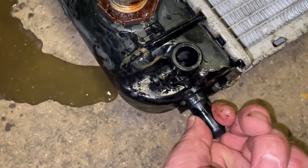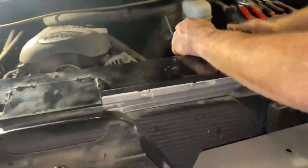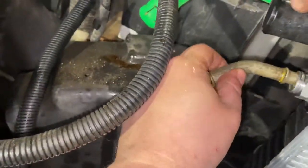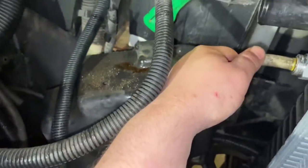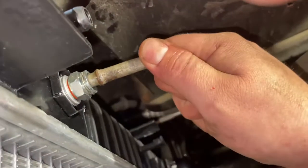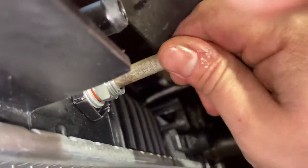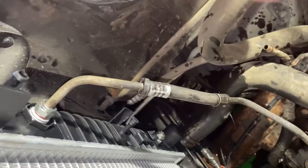The bushings click in. Jamie's over here tightening the first bolts up top. I'll show you how these hoses go in: your transmission hoses and oil cooler hoses — we got the new clip and new fitting in there and they just snap right in. The oil cooler hoses are a little harder to do with one hand. Make sure it's clean where it counts — a little oil is fine. You hear that snap? It's locked in. Do that on all four and hook your hoses back up.